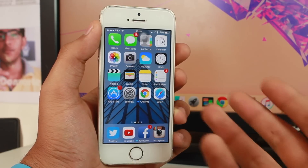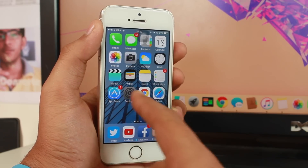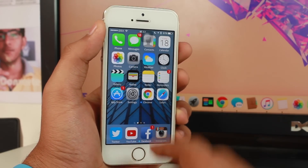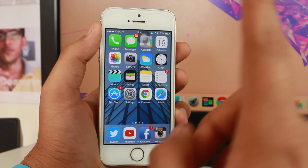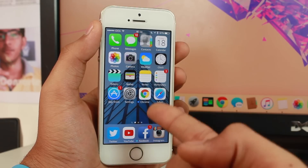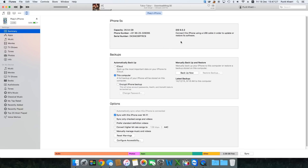As a last resort, if Wi-Fi is still not working, go to Settings, then General, scroll down to Reset, and select Reset All Settings to restore your device to factory default. All data from your device will be removed, but you should then be successfully able to connect to Wi-Fi. I mention this last because it is the ultimate option — you will lose all data. You can do this from your device itself, or connect via a USB cable in iTunes and select Restore.